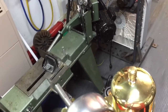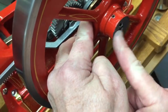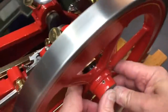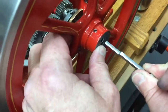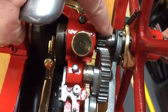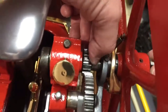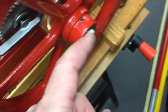Wind the keyway up. The simple thing here is when you're tightening this up, have this flush with the crankshaft end — that'll put everything where it's supposed to be. So flywheel flush, put the keyway in like this. Remember that has to slide underneath that piece. You're going to leave just a little bit of space when you're pushing it in — in fact the further you push it in the more it tightens up. Leave a little bit of room right there.